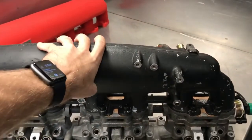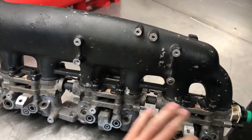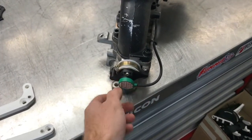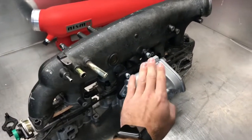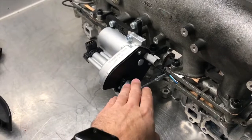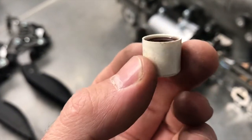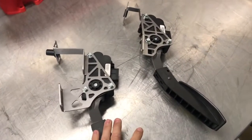In front of us we have the entire kit assembly with the throttle shaft connectors, which are clearanced perfectly to the throttle shafts and grub-screwed in place. On the back here we have the second TPS sensor with its custom bracket, and then we basically just have our throttle motor mounted on the front of the actuator. We've made a new plate and boss to fit a new bearing to support the shaft of the throttle motor, and it has an integrated seal which allows no moisture or water.